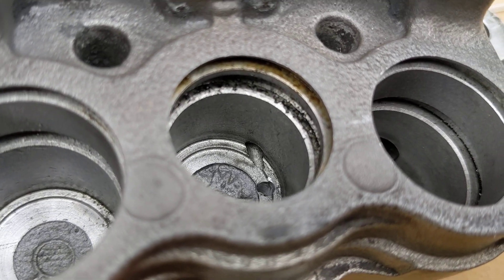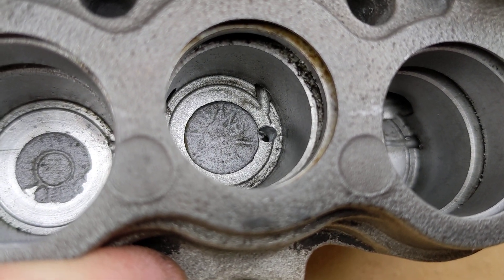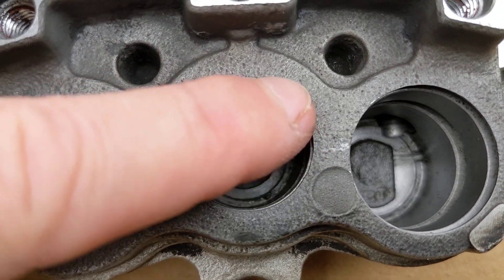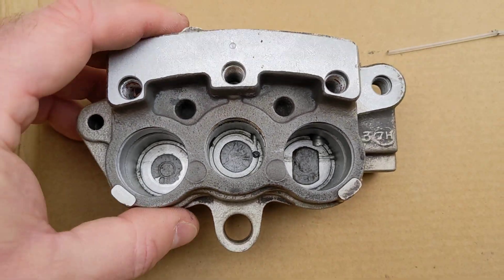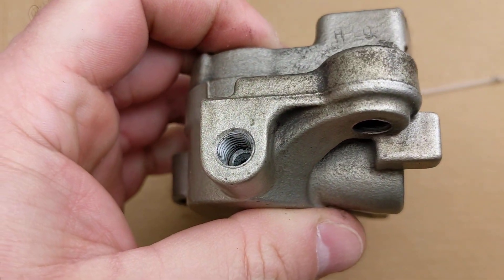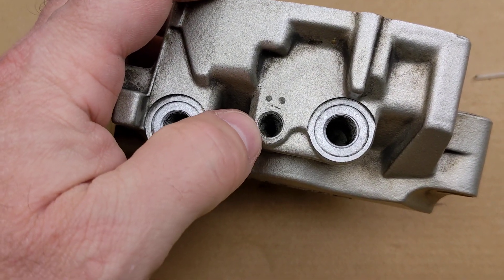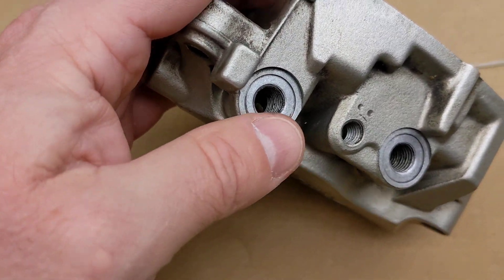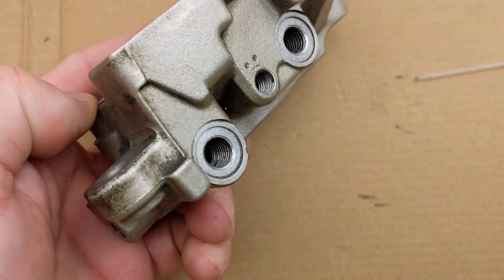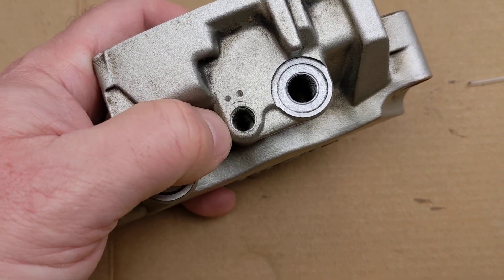With that being at the top, you can see that other bleed hole is up at the top too. That hole into the gallery should minimize the amount of air bubbles that can get caught in the top portion of this piston. So it's not terribly difficult — it's taken me a little while to get around to doing it, but it's done the job. Now I'll blank off this and blank off that, so this will just be one brake hose onto there, one bleed screw there. Maybe I'll leave that with a bleed screw in it — we'll see.